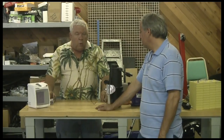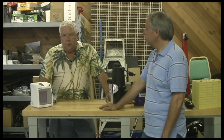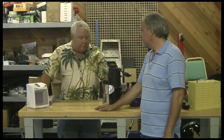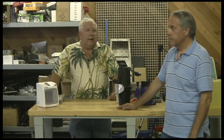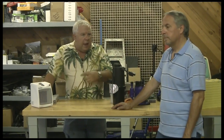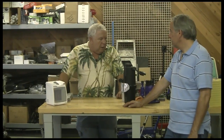For this car we need more power — this vehicle is accustomed to having an endless supply of heat from the internal combustion engine. Most of the energy you put into an ICE engine in the way of gasoline is blown out the front of the car through the radiator, not through the exhaust. It converts gasoline to heat, and motion is almost a byproduct. The whole front end of your car is designed to get rid of the heat, but we tap off part of it and run it into a heater core under the dash. So we're going to talk about how we can electrically make that happen.